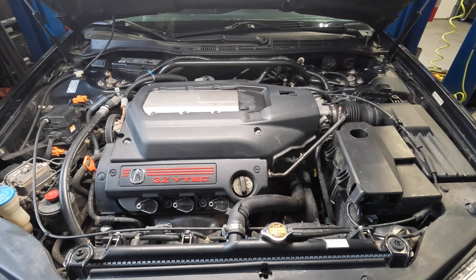Going into the radiator the coolant temperature was 200°F, coming out it was like 190°F — creeping up to 195°F. They were basically too close to call; there should be a wider spread there. That kind of made me think something is clogging up the system, maybe a radiator clog. But it was pretty consistent and even all the way around, so I had to do a visual inspection to confirm my theory.